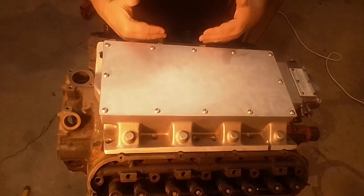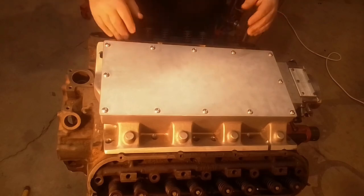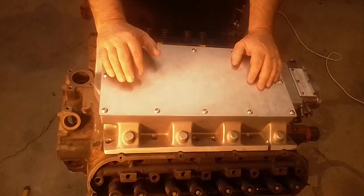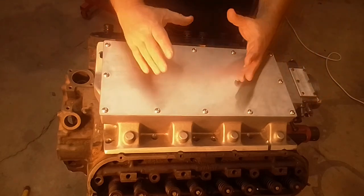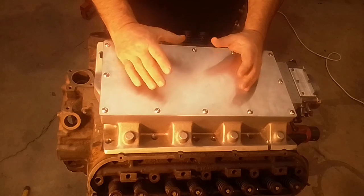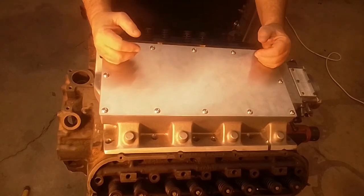And the next task on this is to get fuel rails done and the intake drilled for fuel injectors. Both of those programs will then be at Cadco, so that if you wanted to use this intake maybe without this throttle body, like I said, you could do, there are Dominator throttle bodies. We could do a different top, and still just drill the intake so that it was fuel injected.